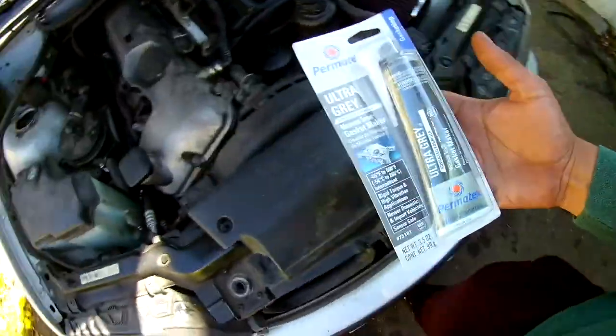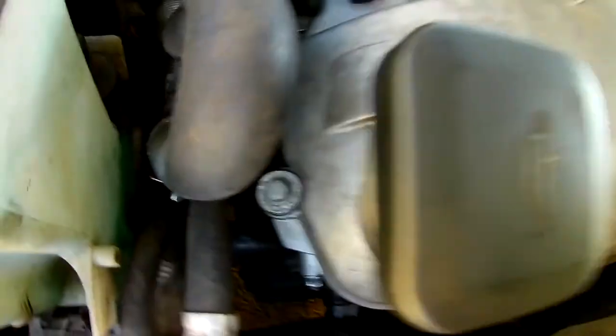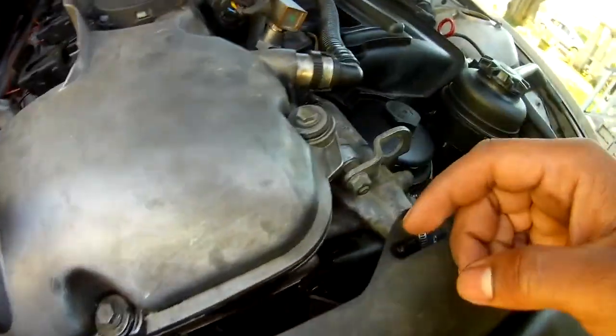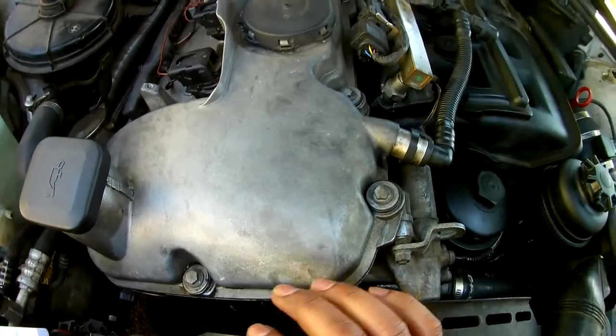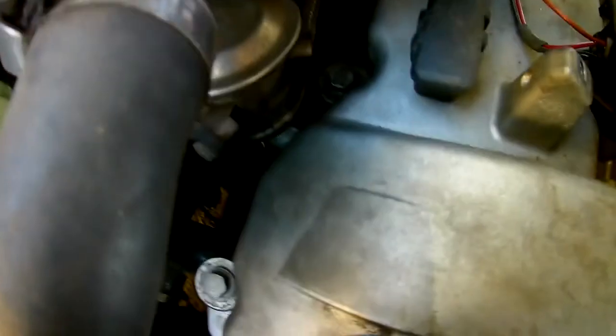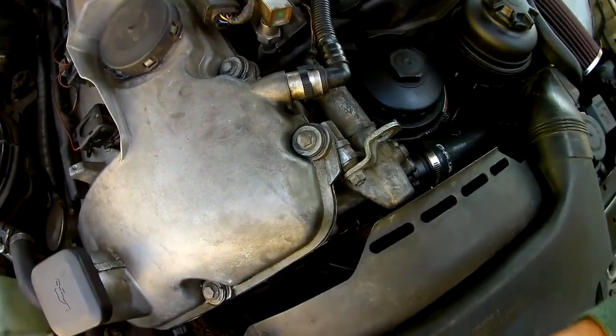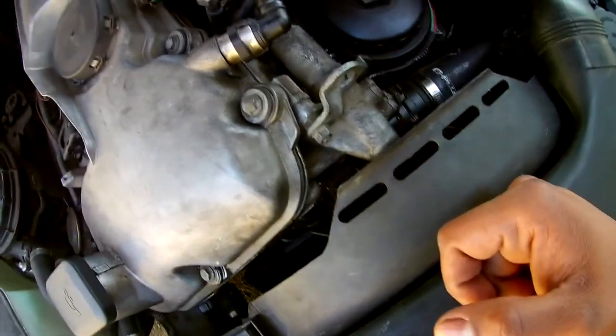What I'm going to do is see if I can fix the problem using some permatex gasket maker. I'm not doing a whole bead, but I know I did not do this to this one. And I know that on the majority of the vehicles and engines, it's right on the hard edges - it's recommendable to put just a little bit, because apparently that's where it seems to leak. I think I remember there was kind of an edge there and I thought about it - I hoped it wouldn't leak - and apparently it is. We're going to give it a good cleanup on the valve cover and make sure it seals properly.